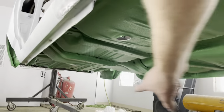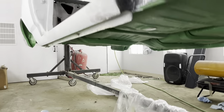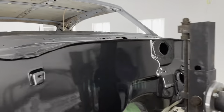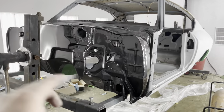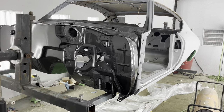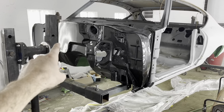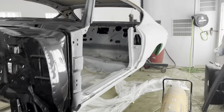The bottom of the car is all green from this point right here to where the firewall is, so all that's already done in green. I've shot the dash the same color. So that's it for this part of the 69 Chevelle. It'll be slick as glass whenever we water sand and buff it. I got it about 80 degrees in here in the booth, so it's pretty hot right now. Next thing we're going to do, we're going to water sand and buff this firewall, and we're going to get this body right here down on the frame so we can address the back of the car.